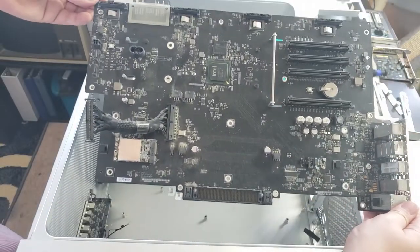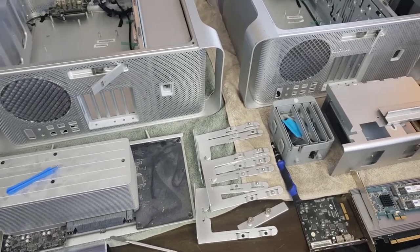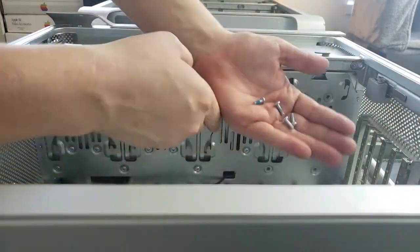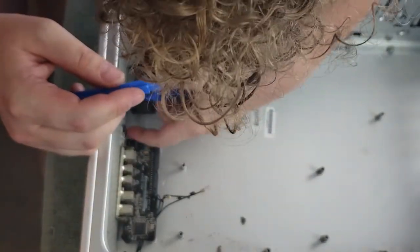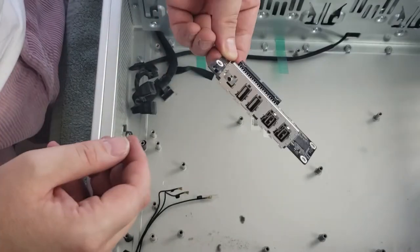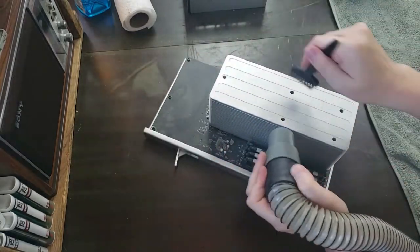Make sure you disconnect all your cables in advance — there are some very thin ones for Bluetooth and similar. We're halfway through; we've got almost everything out except the power supply, which we're taking care of right now. Four screws hold it in from the bottom, and then it's an awkward wiggle to get it out. Moving on to the front I/O and the power button — the power button on this machine was a nightmare. The previous owner had removed the power button from the clean case, so this one had to come over, and it was terrible.